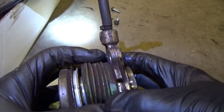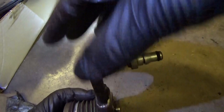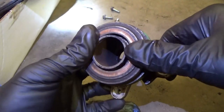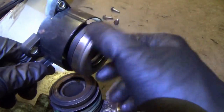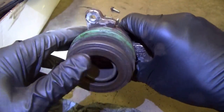There's no clutch fork, there's no external slave cylinder mounted on the bell housing — it's all right here, right on the input shaft. That's kind of a European design. You can see the bearing here: on the old one the whole thing spins, and on the new one it's only the inner ring.